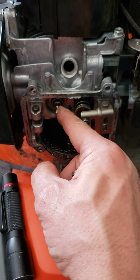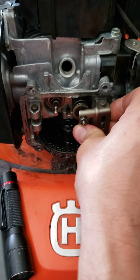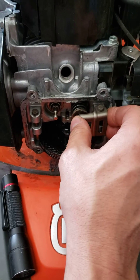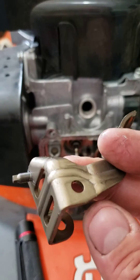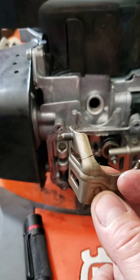After some research I discovered that this exhaust valve right here was stuck. I took the rocker cover off and I could press down the intake valve no problem — it's good and adjusted — but the exhaust valve would not move. I also figured out that this rocker is busted, so I got a new one on order.